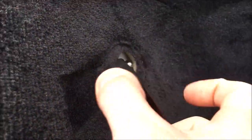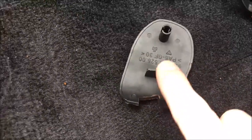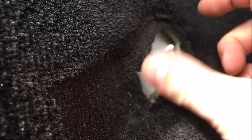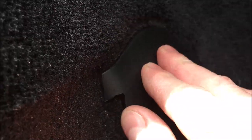First things first: get off the seat bases — two bits of velcro, dead easy, lift them up and out they go. Next, the seat belt receiver. All you need to do is pry off the piece of plastic trim. This trim on the back goes over a threaded stud and helps lock it on. The trim on the top receives into a metal spring clip, so it's relatively tight, but get a pry under the top and a pry under the bottom, move them independently, then put the bolt back in and store it. The clip simply pushes back on that nut.